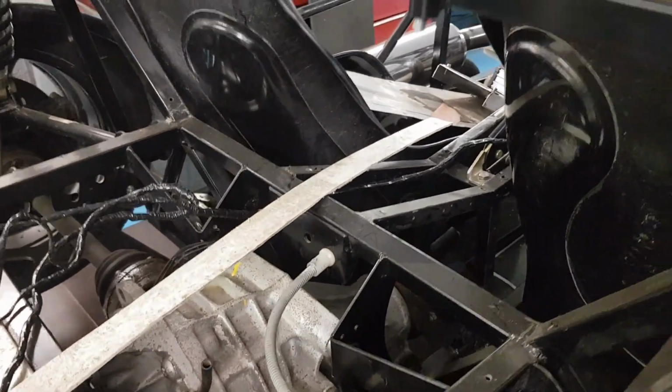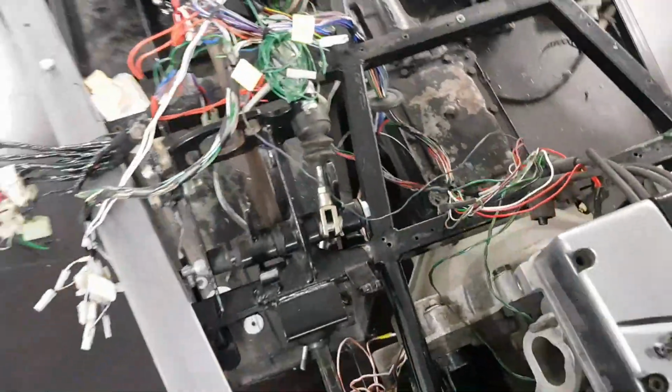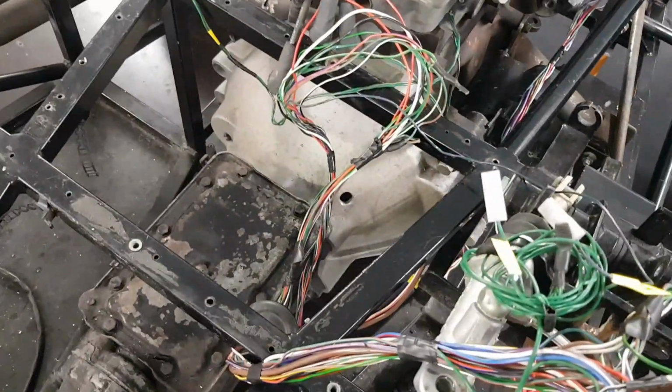On the GBS Zero, they have the brake light switch right at the back on the T-piece where they split to each wheel, but the Tigers must have their brake light switch near the front. So that's not a problem for me because I haven't made any brake lines yet, so it's better to find out now. So I'll put the brake light switch somewhere at the front.